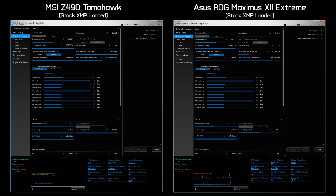Here we see that the Ryzen processors still largely dominate AES encryption performance, and the SiSoftware Sandra benchmark is one of the more balanced tests. Despite that though, the 3900X was 55% faster than the 10900K. Here we see that the 10900K is just 16% faster than the 9900K in the Blender Open Data benchmark, and that made it 20% slower than the 3900X. However, enabling MCE does boost performance quite substantially in this test, as the all-core clock speed increases from 4.3 GHz to 4.9 GHz, though, as you'll see later in this video, that has quite the impact on power consumption.